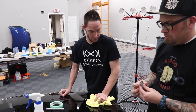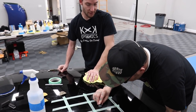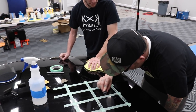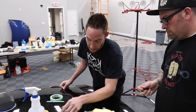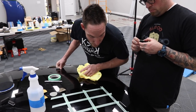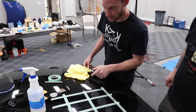We'll do 3,000 over this guy. Finish it. And really try to focus in on less pressure, smaller movements, kind of a jitterbug, and just guide the block. How'd that feel? Good. And again, there is a little more leeway with the cushion. Okay, color wise, it's all consistent. Let's 3,000 this a little bit larger area.